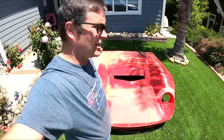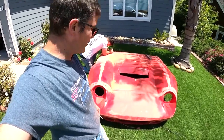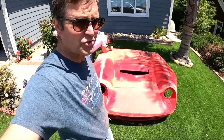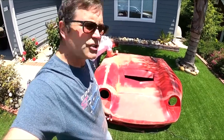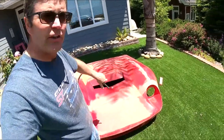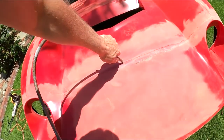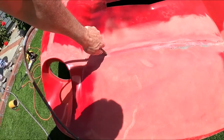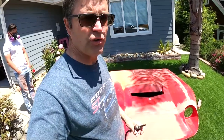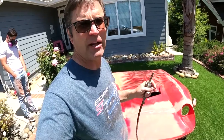Okay, I think you've seen enough of that. Maybe we'll show you some body filler time once we get to that stage — we'll start floating some filler into some of these gaps. I'm going to take compressed air and run it into the gaps like this to help blow anything that's in there out. Then I can come back through with body filler. I'll gap this thing, wipe it all down with a damp rag, and then it's body filler time.